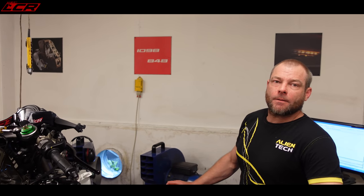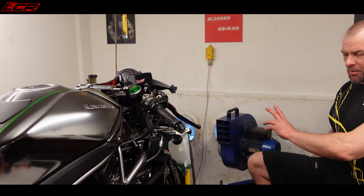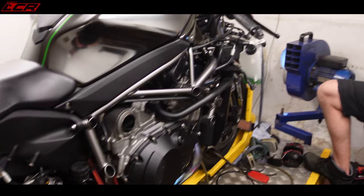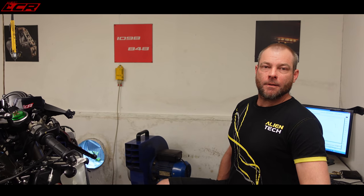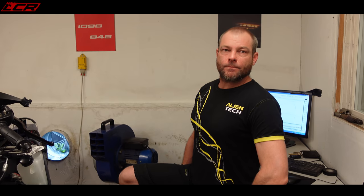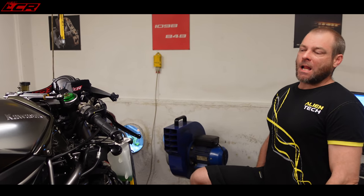So what's the plan now then? You're happy with the fuel now? So the fuel is perfect. The ignition's perfect. The cylinders are perfect. We're just going to do a couple of experiments on the throttle progression to try and get rid of that big surge. It wasn't terrible, but you know what I mean. You've improved it because you put the fuel back in as you close the throttle. And I've adjusted the ride-by-wire as well, the first transition. So I'll have a try then too.